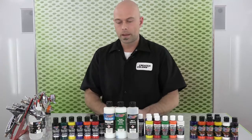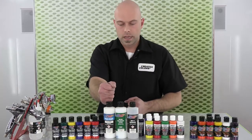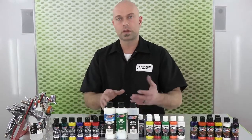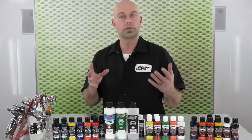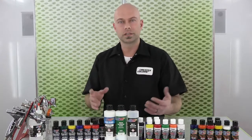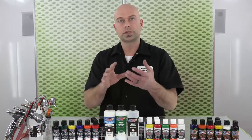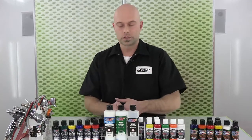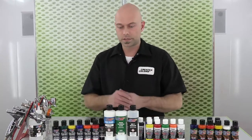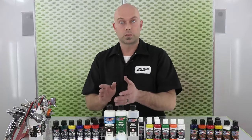We'll also cover our 4030 Balancing Clear and our 4050 UVLS Gloss. These are not a must — you don't have to add these materials to the Createx paints — but for automotive type applications, hard surface applications like aluminums, motorcycle tins, and helmets, this is going to make the paint perform that much better. What you're doing is taking an acrylic and creating an acrylic urethane, so it helps in terms of durability, taping, and graphic type applications. Use the 4030 or 4050 at around 10% to 20% addition.